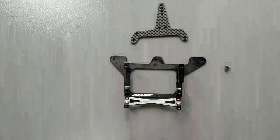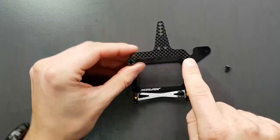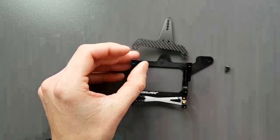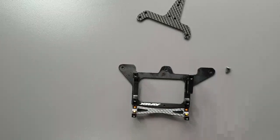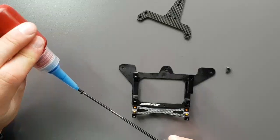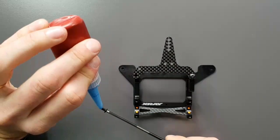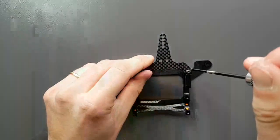Something I will admit is a bit of a weak point on the X12 is the upper screws for this top plate. These two screws have a tendency to come loose, even if you're not in a crash - just driving, after some time they can come loose. So even though you keep tightening them down, it will add some security to not use the aluminium screws that I used for the rear X-piece, but use the supplied kit steel screws and just add a tiny bit of medium strength threadlock to tighten these down.